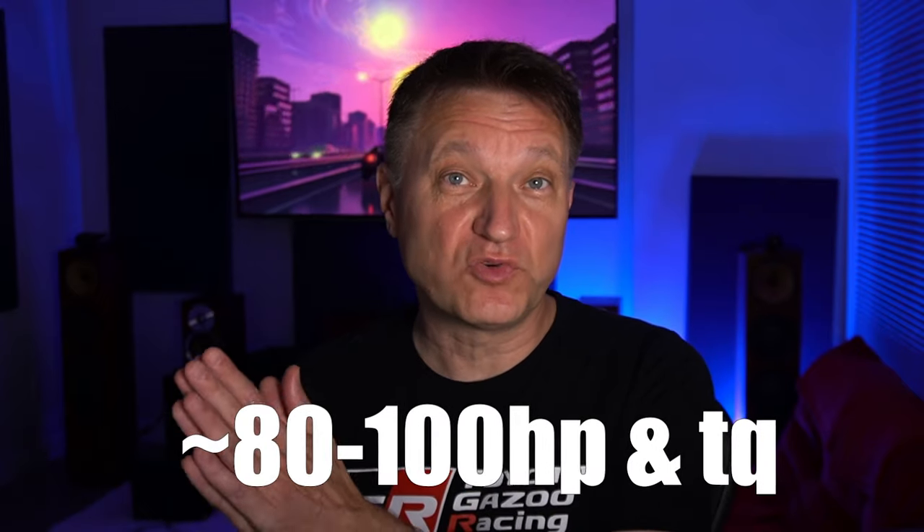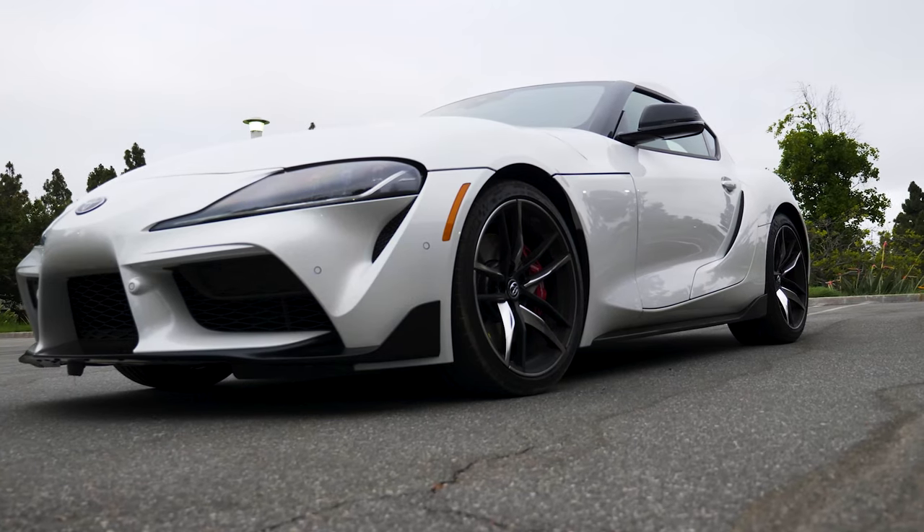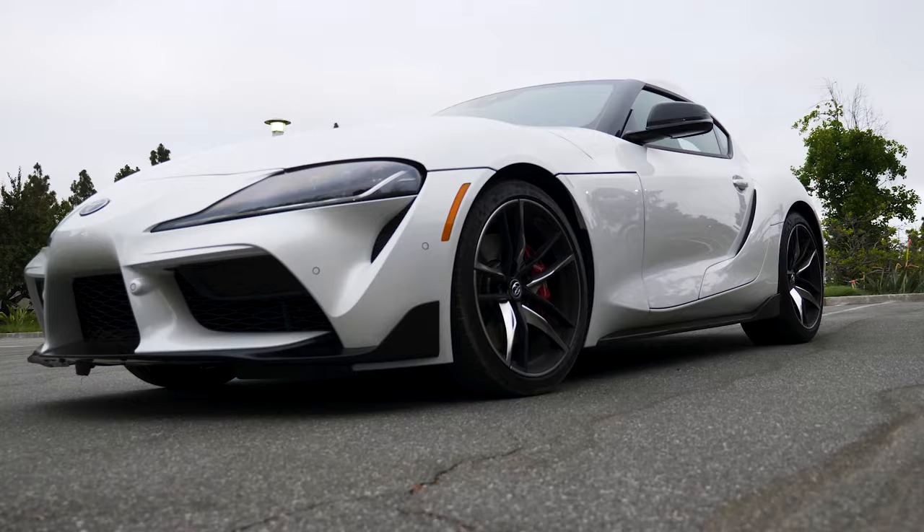It's going to depend if you have a 2020 or 2021 Supra. If your Supra is built after about June 2020, you might just want to call it a day with the piggyback tune, because the ECU is encrypted after that date and so far no one has actually cracked the encryption and made it available for sale to the public. I'll talk specifically about that in just a second.